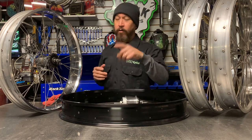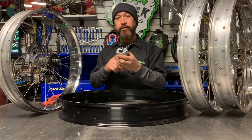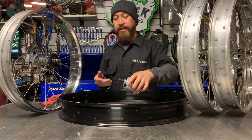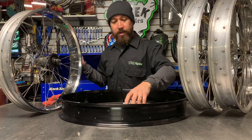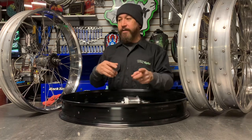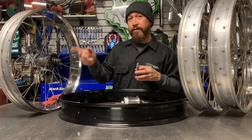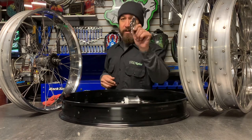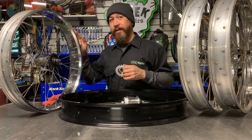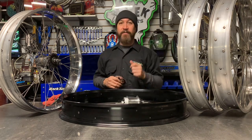Going forward in the video we're going to focus on the Nexus 3. The Sturmey isn't as readily available — the Nexus you can find at pretty much any bike shop, online, eBay. Price-wise they run about a hundred dollars each, complete with the shift unit. The biggest reason we're going to focus on the Nexus is because it's been proven to withstand the offset cog, which is required to move up to the next wheel size. So let's go ahead and bring up the 4-inch wide hoops.